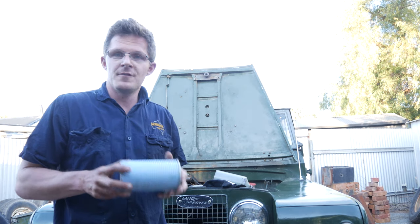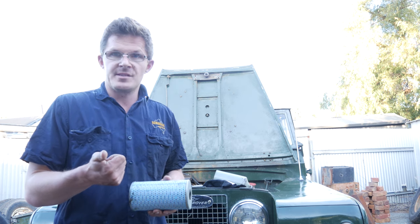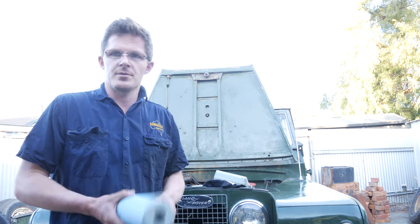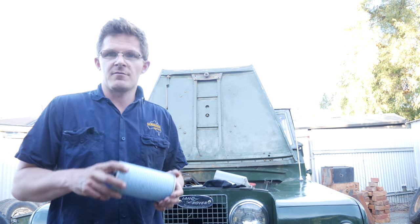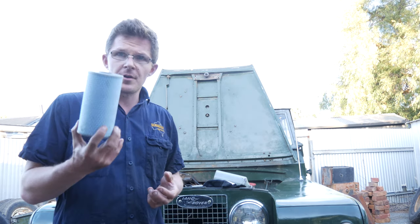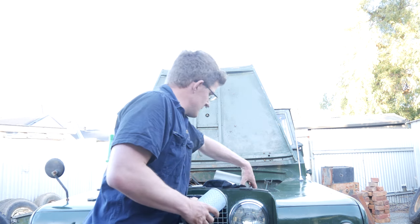The oil filter in your Series Land Rover — and it doesn't matter what series you have, whether it has the diesel, the 1.6 litre, the 2 litre petrol, the 2 litre diesel, or the 2.25 litre — they all use a cartridge oil filter. This one's a Britpart, and some people put an S in front of Britpart. I've used these for the past eight years and the vehicle's running fine. This is the cartridge as you can see here — paper on the outside, cardboard on the inside.